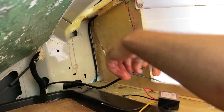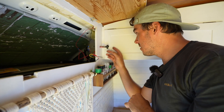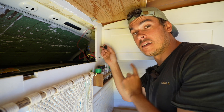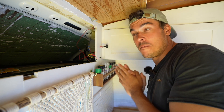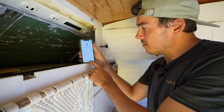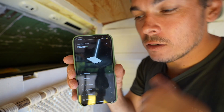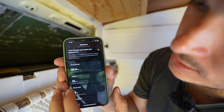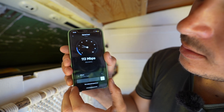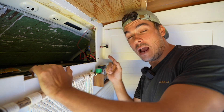I've just wired this all in rough before I go and tidy it all up and secure all the connections. I just wanted to test if it works. If I click this button, the light should come on and I should start getting a Starlink signal. Light comes on — that means we've got power. There we go — my Salty Van Ventures WiFi signal. Now if I open the Starlink app, it's connecting, searching for satellites. We are online. If we check our statistics, we have a 25 watt power draw. Let's just do a little speed test.